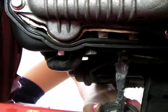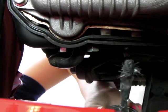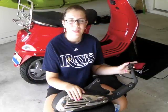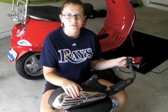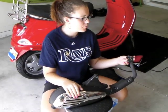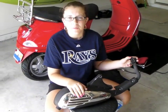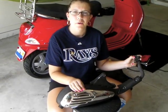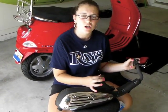I'm now going to reinstall the exhaust, but before I do, I'm going to put some anti-seize on the two bolts that are on the exhaust flange. Now I'm going to install the muffler. First, I have to install the prongs through the flange. Then I'm going to put the bolts loosely on the opposite way of how I took them off, starting from here and in here.